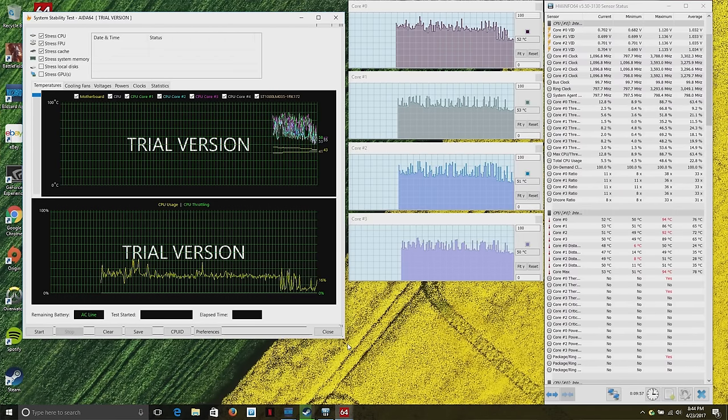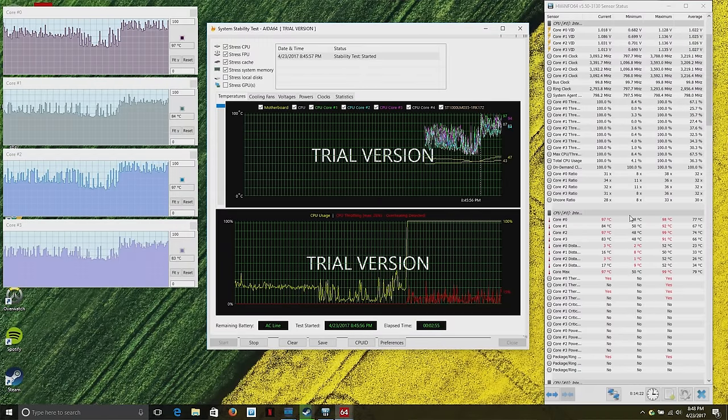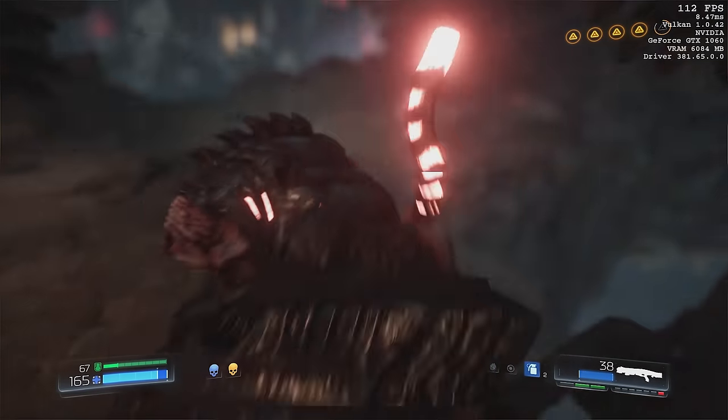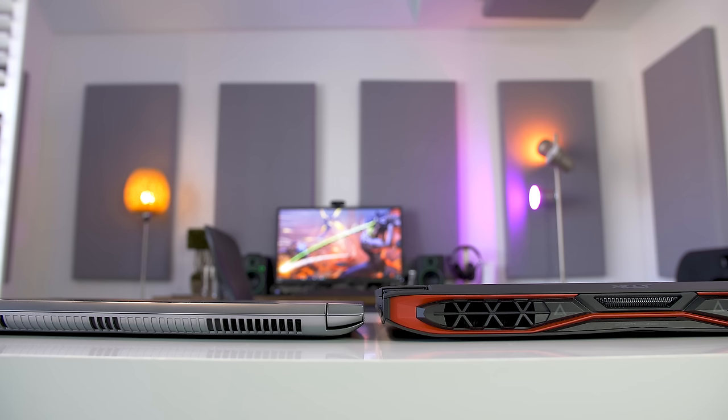Even at idle the CPU temperatures would sit around 63 degrees Celsius, which is much too hot. There was lots of thermal throttling happening with CPU temperatures sitting in the 90s. I also tried Doom — frame rates were great, averaging around 100 frames per second, but again the computer was just getting too hot to use. I'm surprised because Acer's gaming line has been some of the best at cooling. It's possible they tried to cram too much into such a thin frame compared to the thicker Acer Predator 15. I've read reports of some Nitro units having this issue due to thermal paste not being applied properly, so I'm going to request another review unit to see if it has the same issue.